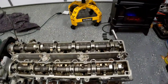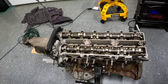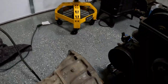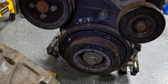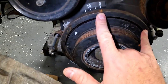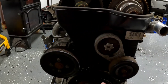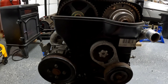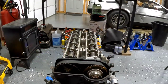Look at that bad boy — it's like brand new inside. Hopefully the pistons look the same. So now here you can see there are two timing marks. Zero and 60. Now what the manual says to do is rotate it to zero. If you don't see any timing marks, that means we're 180 out. So then it wants you to rotate it back to zero and then back it to 60 degrees before top dead center before you take the cams and everything else off.